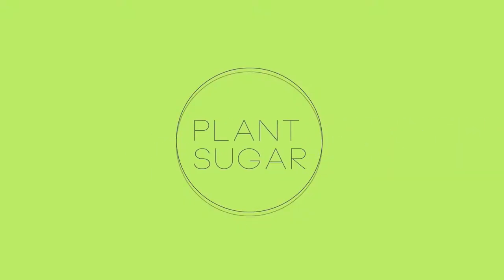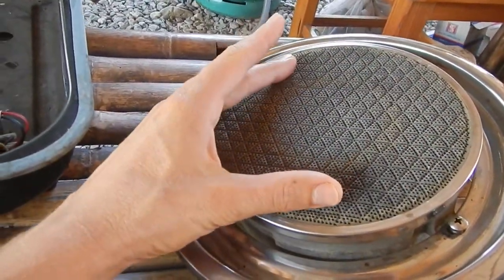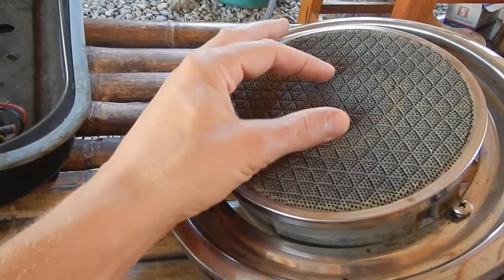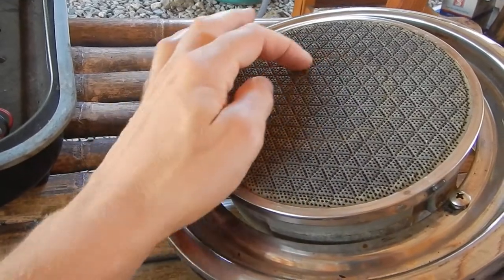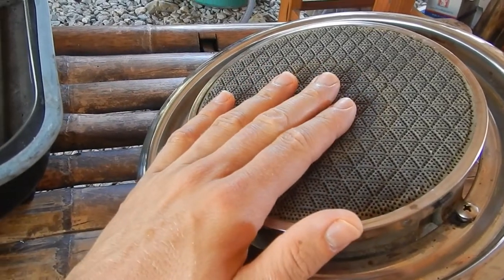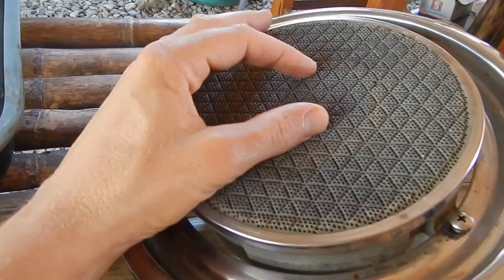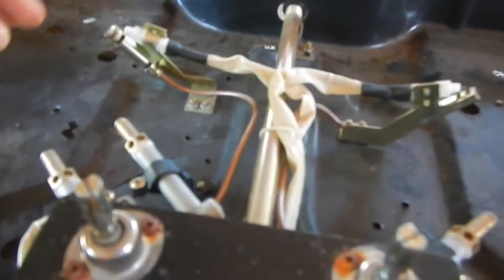Fixing a gas cooker. The problem was that only the outer part was getting hot and the middle part was not getting enough gas to make even heating. The problem was probably that something was stuck somewhere, either in this part or at the blowouts.